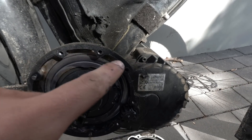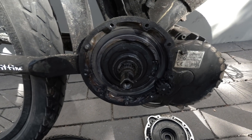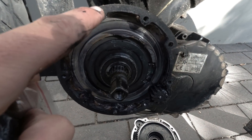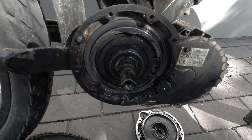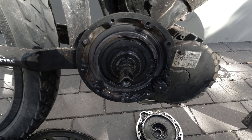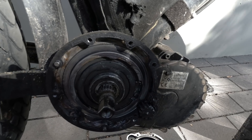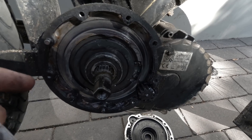One point about this gasket: be quite careful because it's easy to rip. If you're cycling outside Europe where you can't get spare parts, take a spare one and find a way to protect it flat - I had a piece of cardboard either side taped around it. Just be careful when putting it together and taking it apart, as this is what keeps water out of this section.